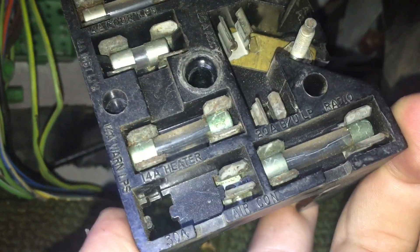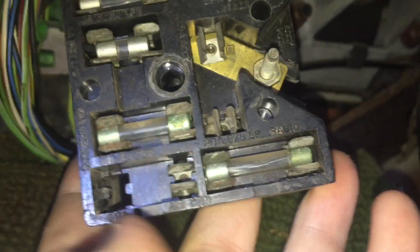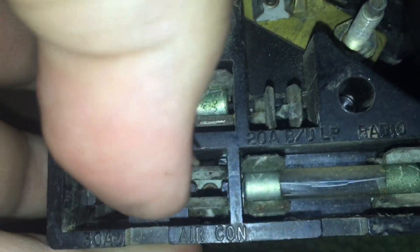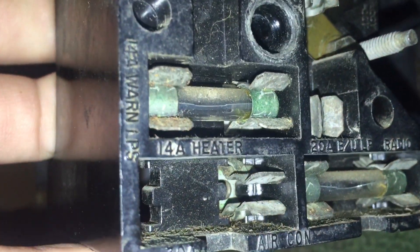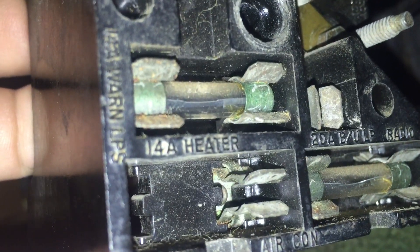It's a quick addition of a fuse. Right here I wanted to show — if you wanted to put in a new fuse connector, it's meant to go right in there, it just pops right in. To get these out, at the top and bottom of this connector you just go in there with a flat blade and pop out that tab, push it down, and then it'll literally push right out of the back.